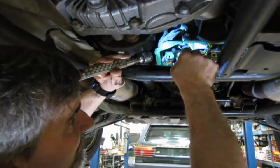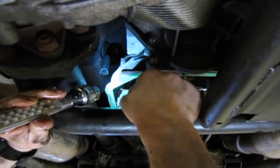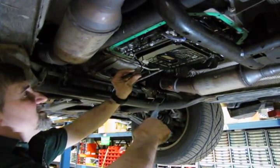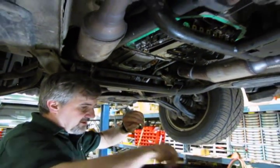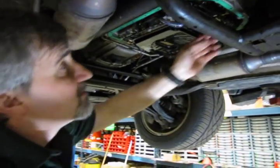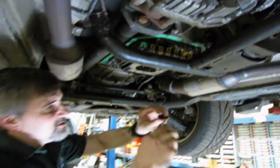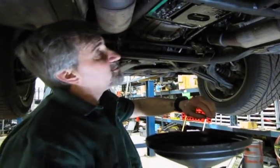We're going to sneak the body of the connector that we just popped out through this opening right here. We've taken the two retainer tabs out — what you've got up front is your input shaft speed sensor and we're just going to unplug that out of the harness and put that in a safe spot. Towards the back is your output vehicle speed sensor. These are basically identical sensors, but we're going to set them so that when we go to reinstall we put them back in the positions they were originally in.